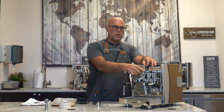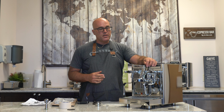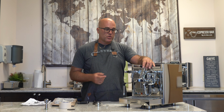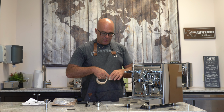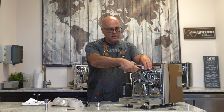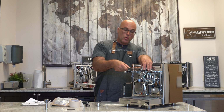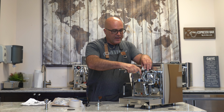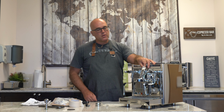Now you can see this knob was basically designed to clear, because this flow control device actually turns more than your other flow control devices. Now, once you bring it down, we'll take this portion off, we'll put some tape on, and what I like to do is righty-tighty, go nice and tight, and then just an eighth to a quarter of a turn, maybe a second. Be careful you don't hit the wrench on the body, and I went a little more. So you may go up to a quarter of a turn, 3/8 of a turn. Take the tape off.